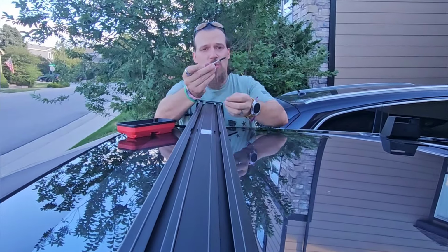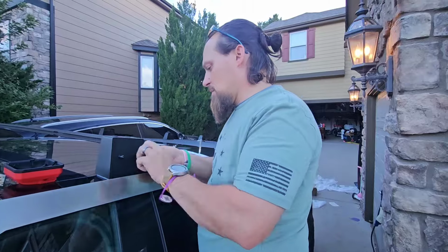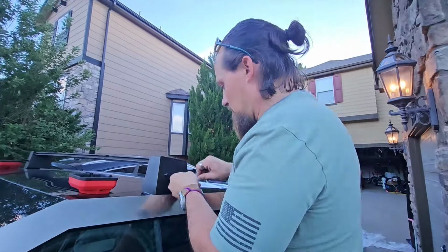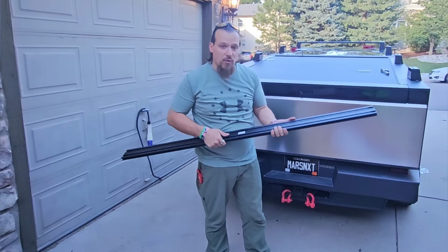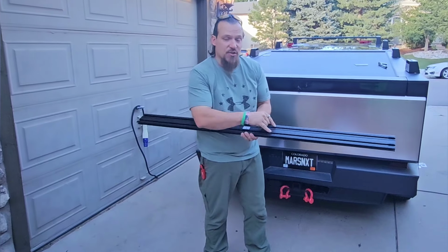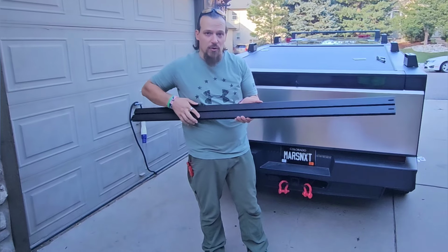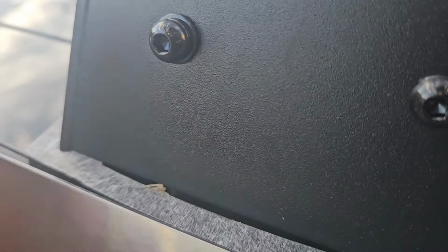Then I'll move to the other side of the truck, removing the rubber grommets, and then again putting in one Allen screw, then the other. Once the screws are in place, you can replace the little rubber grommets you took out back into the top. Then you'll put the end plate back on using the 2 longer Allen head screws that you took out earlier. Be careful not to over tighten these. They're just holding the cover on. Same steps over and over again for 2, 3, and 4. The side that goes up, you'll have the 2 grooves, and the side that goes down towards the truck will be the single groove. I turned my head for a second, and I got a little white spider making a nest in my base.